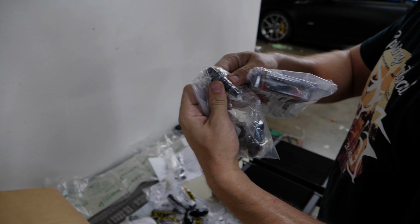We've got some bulkheads so we can weld the fuel lines inside the tank. Obviously I've got that all done already. The tank's out. More Y lines, because it is confusing as hell, but the C5 Corvette actually uses fuel pressure to pump fuel from one tank into the other. We'll go over that in a second.